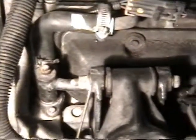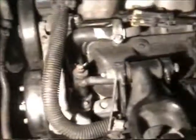Make sure all the hoses are connected. When you add antifreeze, you want to open the bleeder screws — this one right here on the lower radiator hose where the thermostat is, and this one at the air intake. Open those two up and fill it until you see the coolant start to come out. Close that one, and it's supposed to come out of this one once you close that first one. Then just run the engine until it's hot and top it off. That's how you bleed the system after you install the water pump on a 3.1 engine.